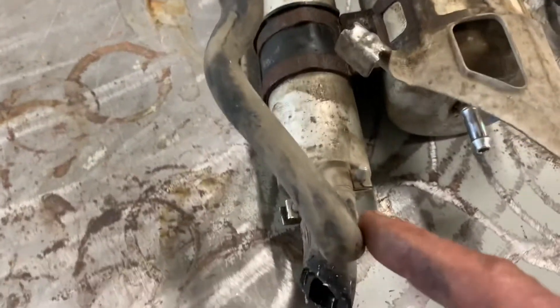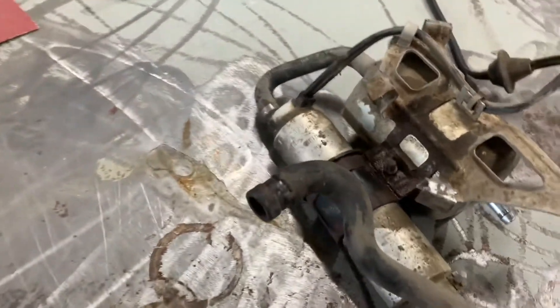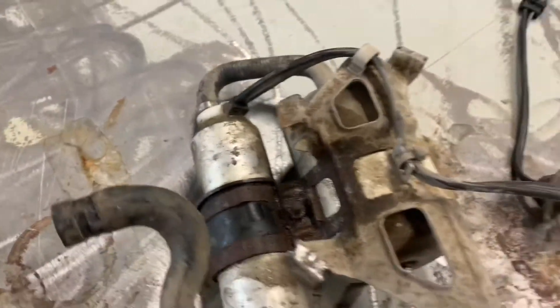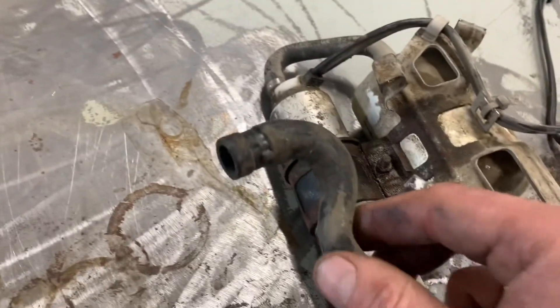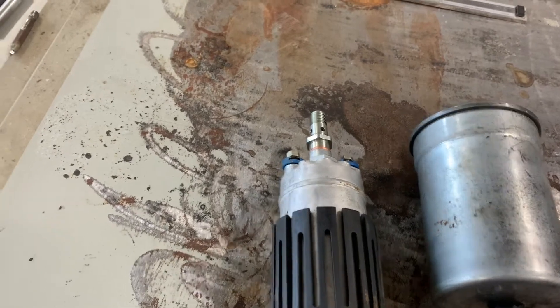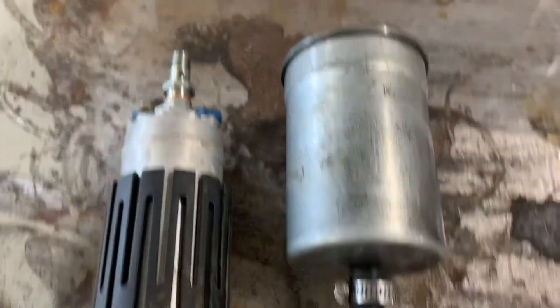There's no check valve on this one — I think it may be internal. I don't have the service manual for this car, so if you guys know, comment below. This is the proper connection. It mounts in the trunk and there's nothing that needs to be done there. We'll clean it up, replace the filter, and put this back in. This connection here goes into the fuel tank — I think it's an overflow or overpressure connection. In my car this was actually plugged off since there was no place to connect an overflow hose.